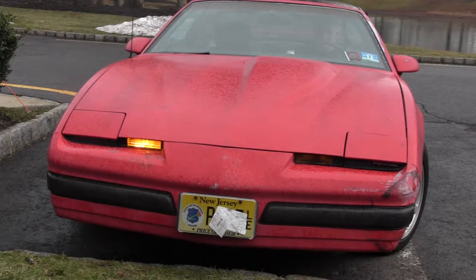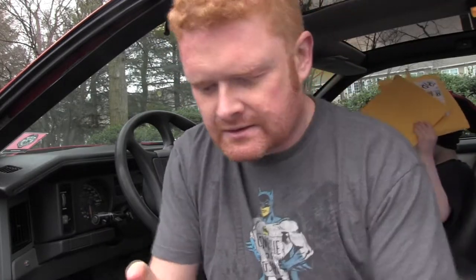While we're on the subject, there is the second quick and easy job I had to do. Job number two is to try and fix the turn signals. The problem with the turn signals is one of them works — click click click — the other one just stays on all the time. If the turn signal doesn't come on at all that's probably a bulb, but if it goes on and just doesn't flash, they call them the flashers, that is something called a relay. A couple of bucks from Parts Geek, I ordered this, and this should basically be just a case of swapping it in and out.